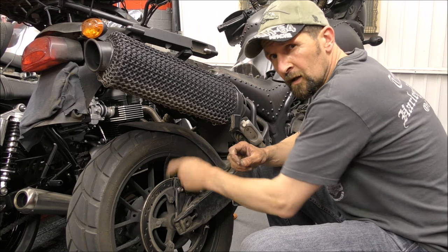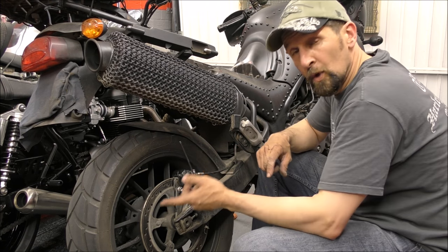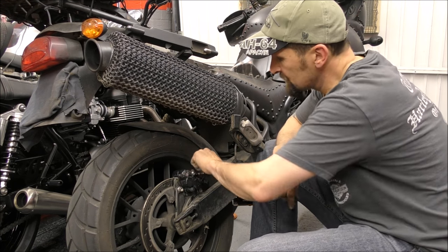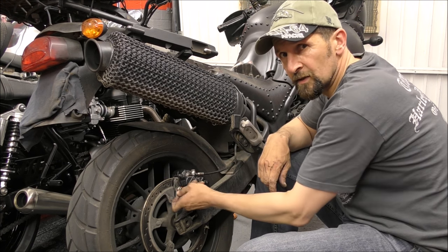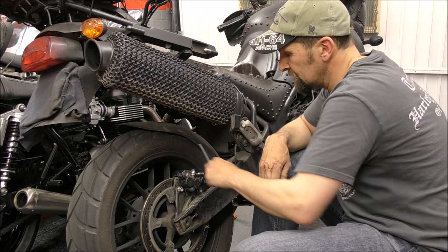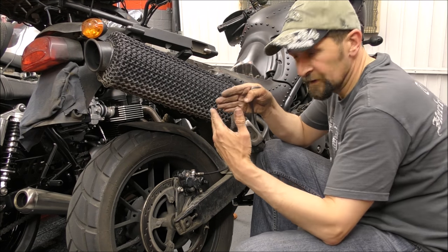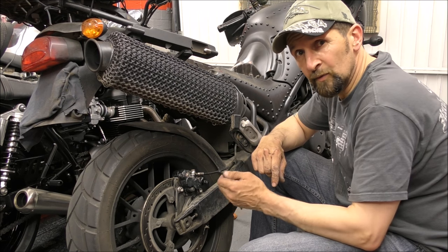Right, there we go, done. Now, on putting the pins in, I work them in as well. Like when you work them out bit by bit, I work them in as well. And that distributes the copper slip or anti-seize compound around the thread perfectly, so it's all protected. There we are. Now, that's got to the point where it's just seated. Inside there, the pin's got a chamfer, and the hole is chamfered as well, so it goes in until it seats. Believe me, they will never fall out.